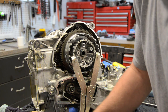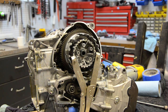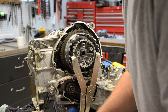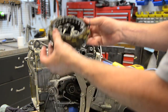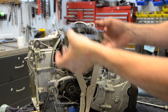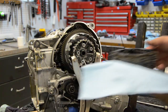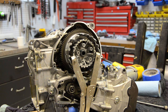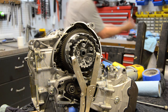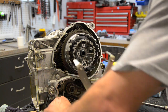I'm actually going to zip tie the entire clutch pack together in the order everything came out of the engine, so it keeps it all organized. Basically that whole pack is all zip tied together — that's everything off. I'm going to put that in storage. No metal contamination on that whatsoever, which is good. Should be able to pop those off.